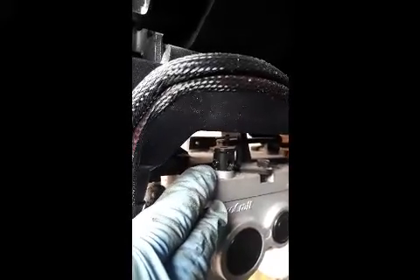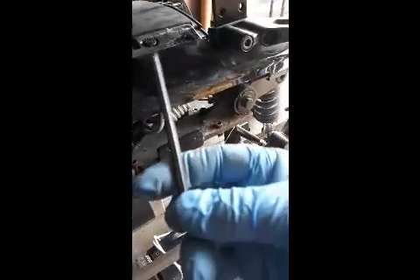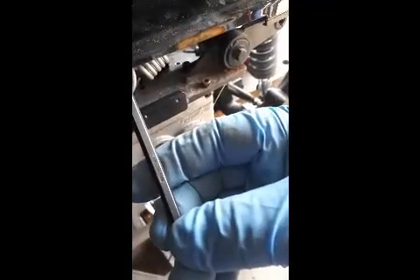You also have to take off this little set screw in here. Right there, there's a little set screw. So you take that off. Oh, there's another bolt — there's the sixth bolt right there. So you just loosen, take those off, and then the motor will drop. You loosen that off and that should drop off the shaft. Unplug your motor from here into the controller and that's how you change the motor.